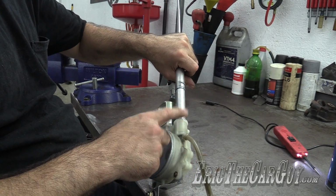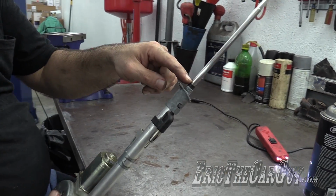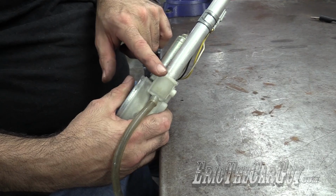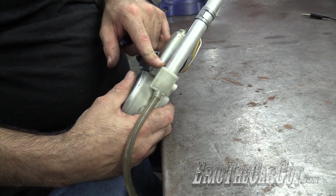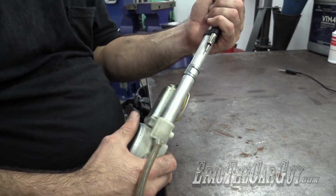This is where the corrosion happens mostly, because the water gets right down in here with the antenna. It's brought down into this area. That's why this drain tube is here. So all the water just sits right here. So whatever salt stuff gets in here, or just the water in general, eventually causes this to corrode, and you see what I showed you earlier.